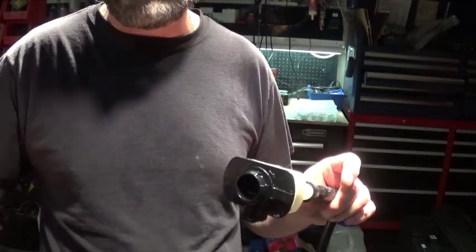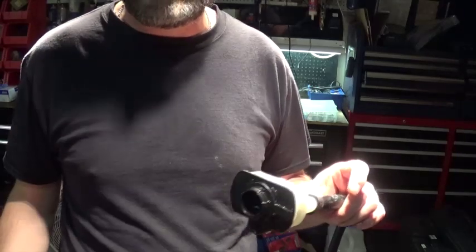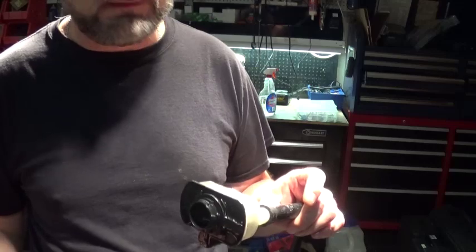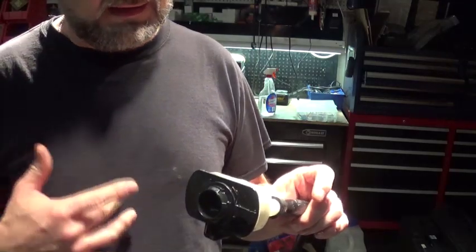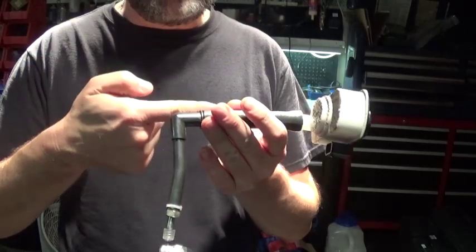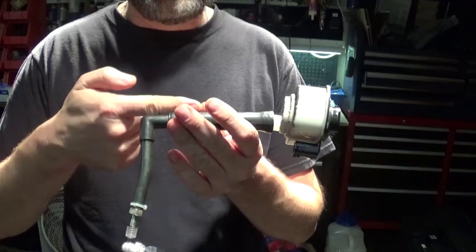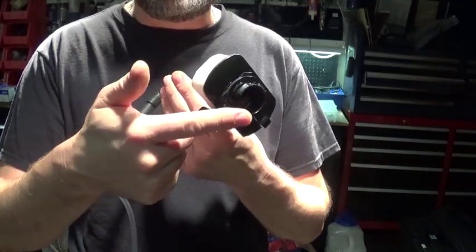I could see that my pressure is on zero, my float is all the way up, I'm pumping the air, but no leaks. I cannot see the smoke. Until I got actually on this side and connected my smoke machine to my vent hose, and then I could actually see the smoke coming out.